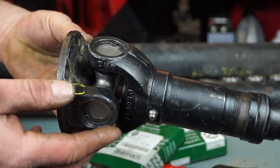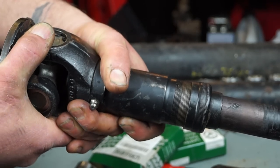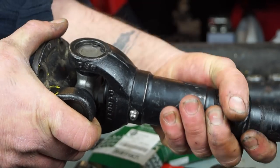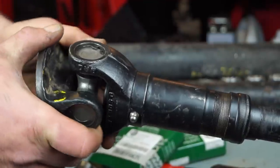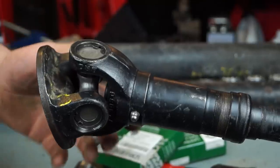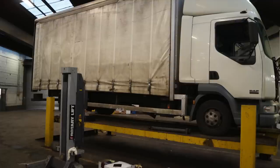When checking your prop shaft, you should always make sure it slides, that there's no movement on the splines, and that the joint is not worn or damaged. If you want to find out how smooth your prop shaft is, you need to remove it and check the UJ — you'd do this if you suspected the prop shaft was causing a vibration because the UJ is stiff. It's important to regularly check vehicles; on this one the prop shaft fell off because it hadn't had an inspection for a long time.